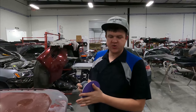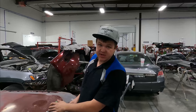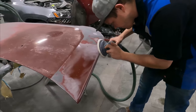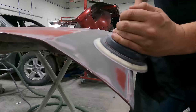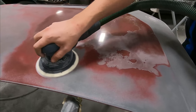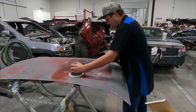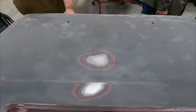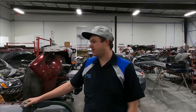We're using the Festool with 120 grit, going to strip the rest of the hood. Got half of it stripped down. I don't have a mask on because I'm using a vacuum-assisted Festool. We got this whole hood stripped down to the sealer. We've got a couple of rock chips to feather out tomorrow and glaze, and then we're going to get this thing all primed. But that's it for now.